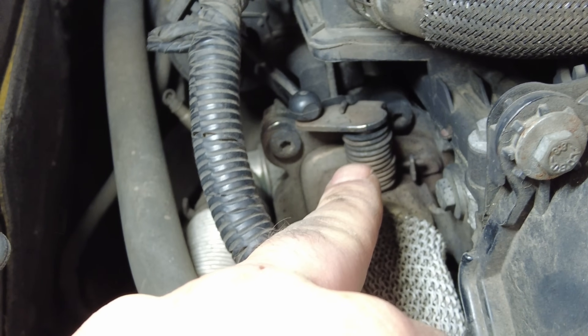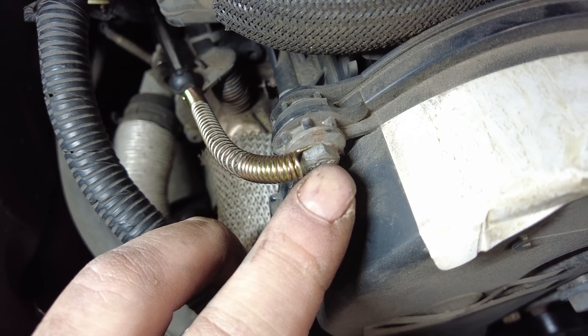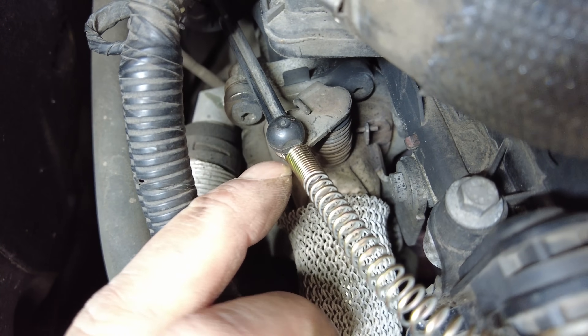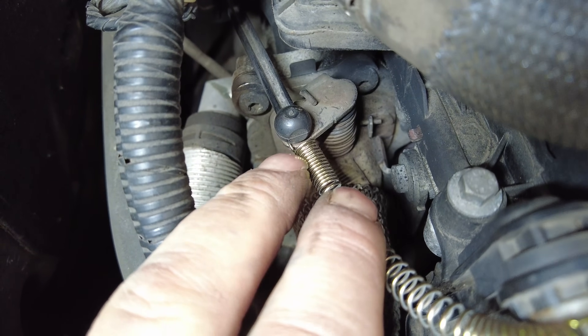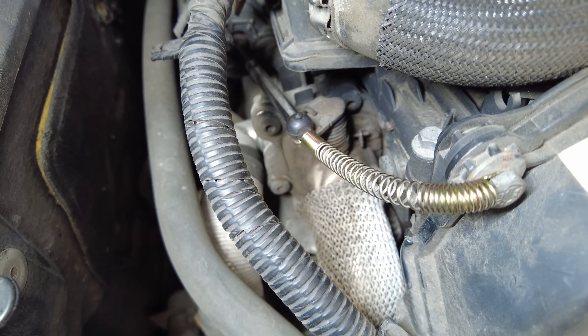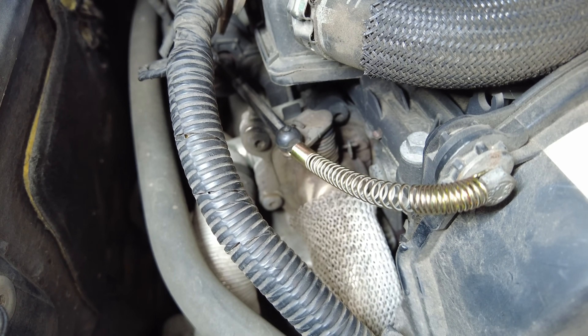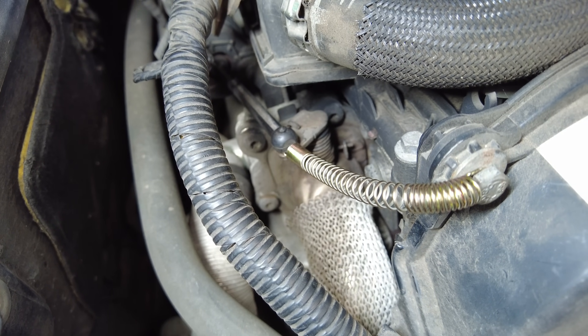With that spring snapped it's not going to open. What I'm going to do is save him a lot of money and get him out of a bit of a sticky situation, because he has got to travel a lot over the next week or so and I'm on holiday and we haven't got time to get it fitted. So I'm going to go through my little junk drawers and see if I've got any springs. What I've gone ahead and done is put a little spring in there off the timing cover top bolt, down to the lever itself. I've just unhooked the ball, slid the spring over, and then clipped that joint back on.